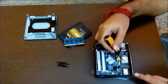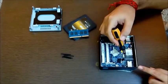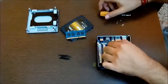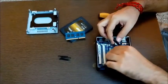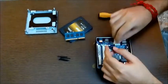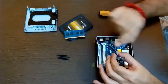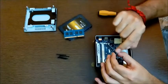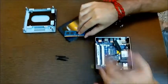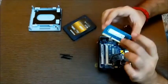First of all, you can see inside we have the Wi-Fi and Bluetooth adapter pre-installed. There is a place for an mSATA hard drive, the two SO-DIMM slots, and this is the connector which will help you connect your solid state drive or hard drive, depending on what you're installing. This is the power connector and the hard drive connector — it comes with both things combined.